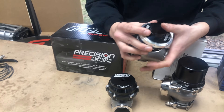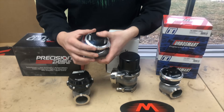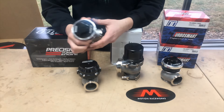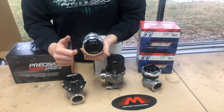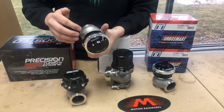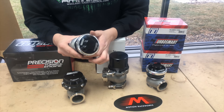There are three ways to put pressure on top of the wastegate: plumb a line from your manifold with a solenoid, which will open and close with manifold pressure. The general rule of thumb is you can make twice the spring pressure — so a 10-pound spring can make 20 pounds of boost with manifold pressure. Alternatively, use CO2 or compressed air. If you put 50 psi in addition to a 10-pound spring, generally speaking you'll have around 60 pounds of boost.